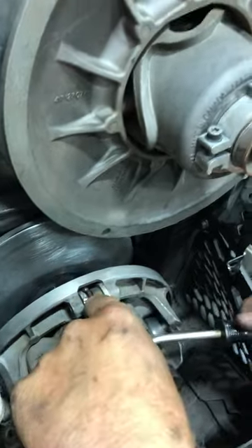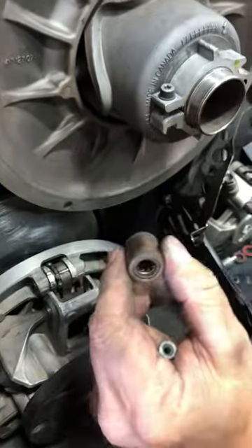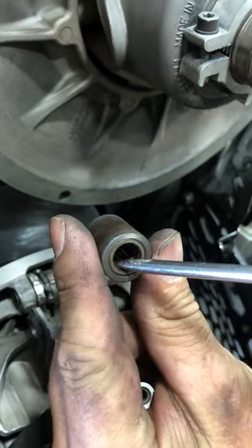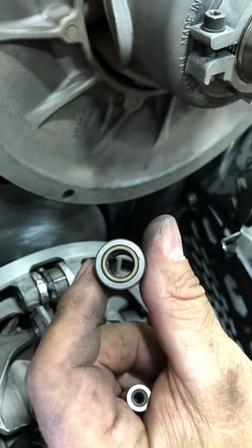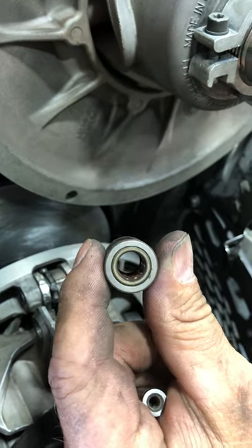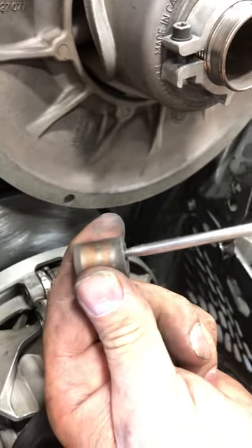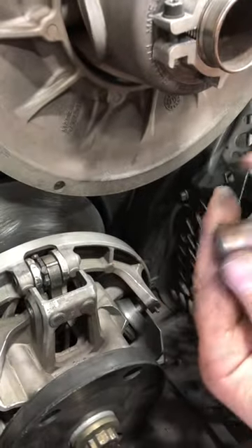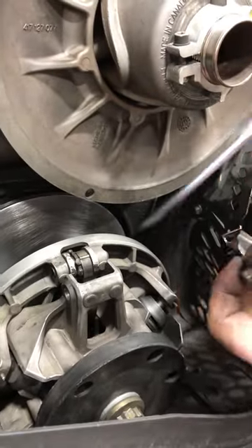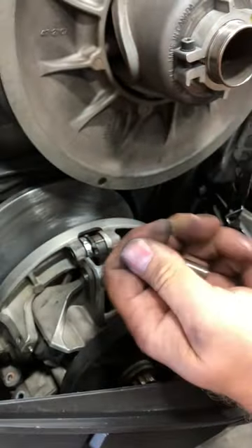One thing unique about this roller — and this seems very unique to BRP — is if you look in here there are actually roller bearings inside, and there is a real light grease that is available to put in there. In years past there was always the recommendation not to lubricate clutches, but this looks like you just put a little grease in here and it will roll on that pin. There's one more spacer down in there. We're going to clean all of this with a number four steel wool before putting it back together.